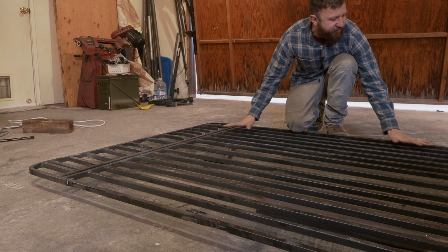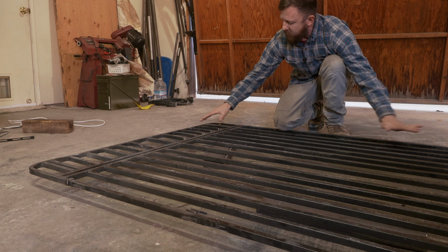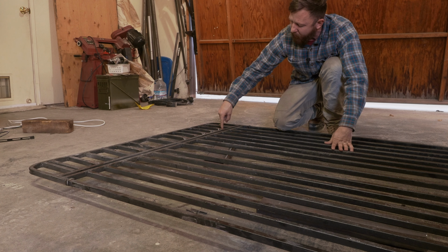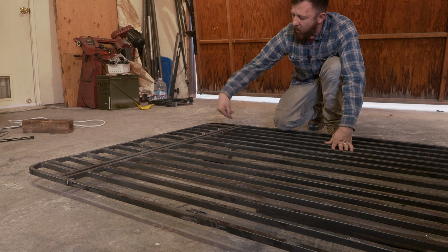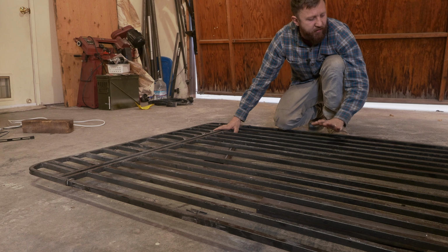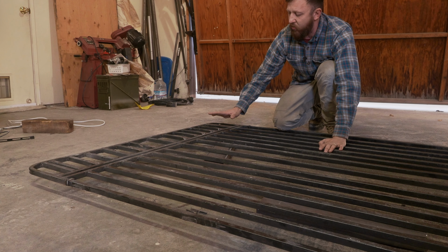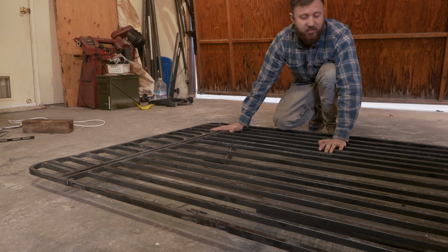So when we have a pretty flat surface, these bars I've already welded in. They used to mount on top, onto here, like onto this cross rail with a bolt that went through it. I lowered them into the frame and then welded them all up. So these are pretty strong. And the bars that I added are all 3/16. Garvin normally uses 1/8. So we're doing pretty good with that. I think this thing is gonna be pretty strong, to be honest, just like it is.